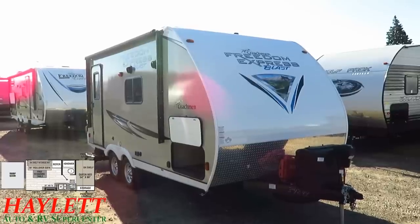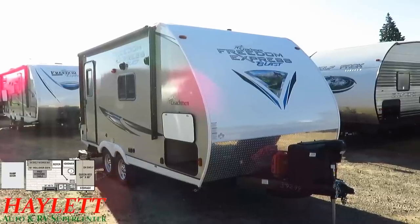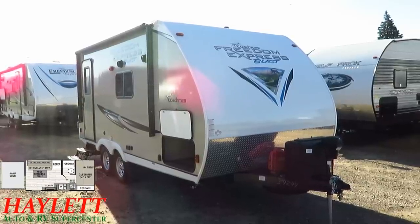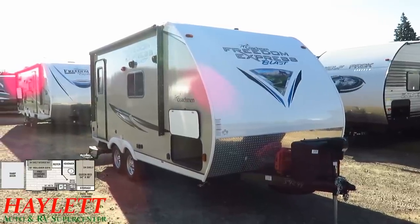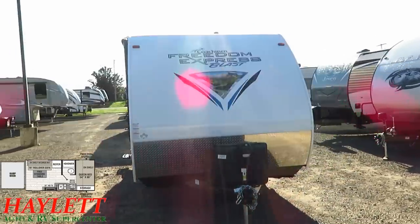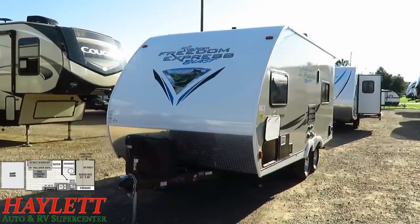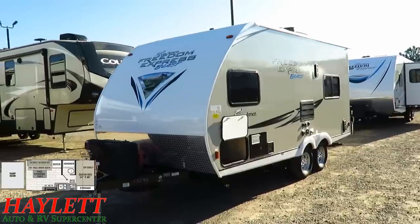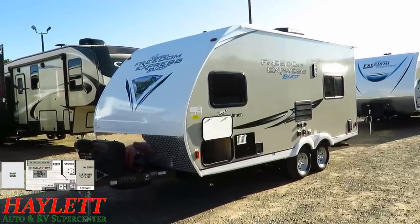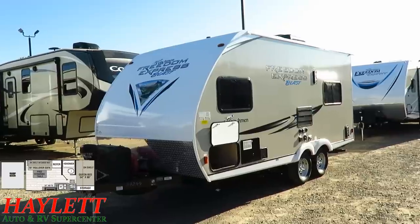I've referred to this one as a crossover — kind of like something that's not an SUV but not a minivan. It's a toy hauler travel trailer crossover. It keeps weight in check by not being extra tall or extra wide, which also means it's not extra expensive. Beyond that, there's a lot of aluminum skeleton lamination in play. It also uses a material called Azdel under the fiberglass skin — a composite resin material that substitutes for Lauan wood panels. It's lighter weight, cannot rot, mold, or mildew, has better sound dampening and slightly better R-values, with superior longevity and exposure resistance.